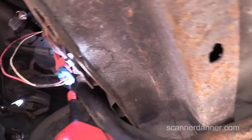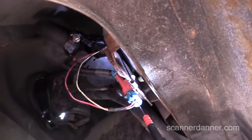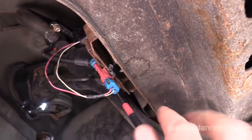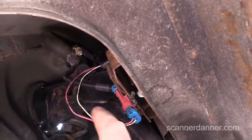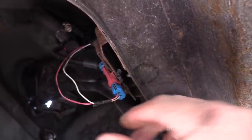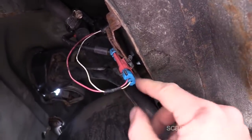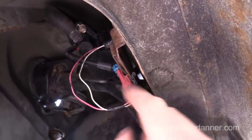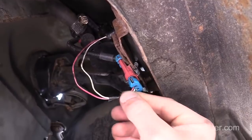What I've seen in the past on every single one of these is the wiring back here — you'll have an issue right in the connectors themselves, actually broken inside the insulation. So for you guys watching this that have an open circuit or low voltage code on these EVAPs: if you read 12 and 0, that's suggesting an open in the solenoid and you need to replace the solenoid. If you're reading 12 and 12 like I have with this same code, then you have an open in the wiring.